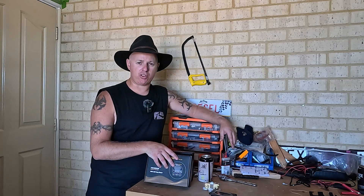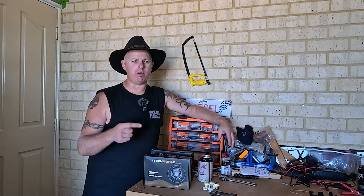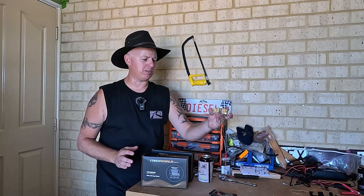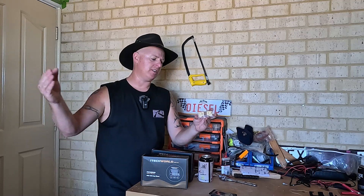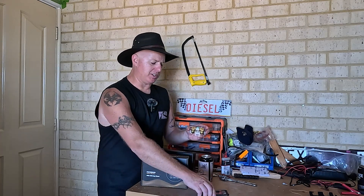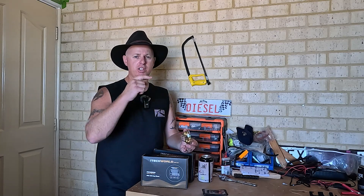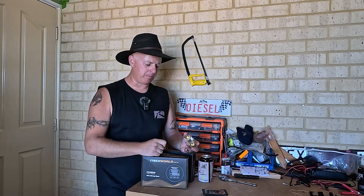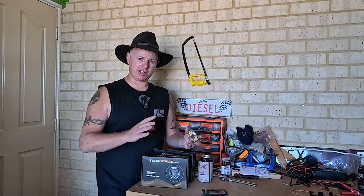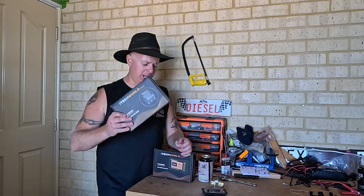With this shunt here I found it pretty good — very simple, very practical — because it tells you how much battery you've got in regards to percentage, as opposed to voltage. With a lithium battery, 12.5 volts isn't a good indicator. The installation was very easy. Essentially all you need is to find a spot for this one here, because the shunt itself basically acts as a pass-through — all the gear you're running goes into here and then you connect this up to the battery, and a cable goes from here to the monitor and tells you how much battery you've got left as a percentage.